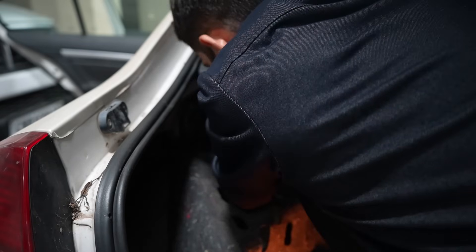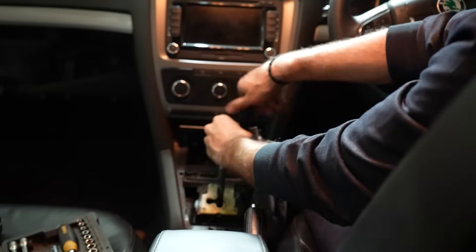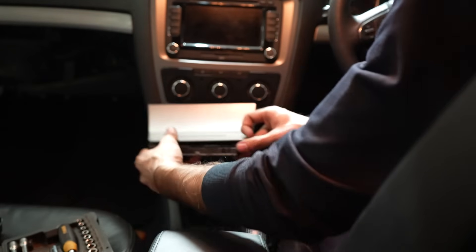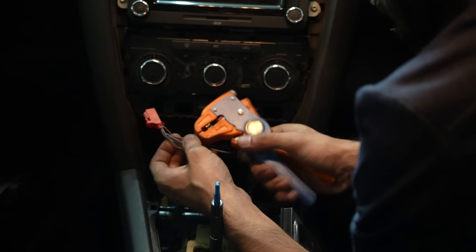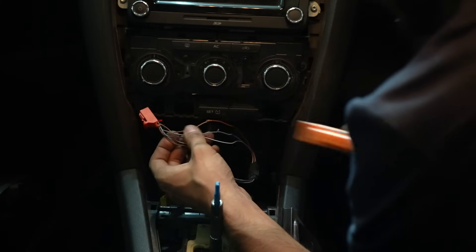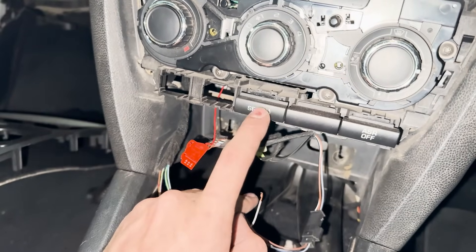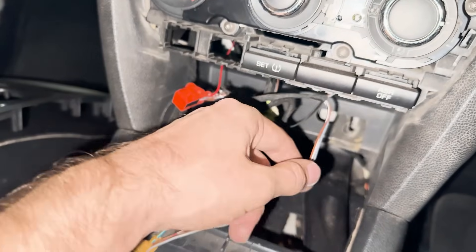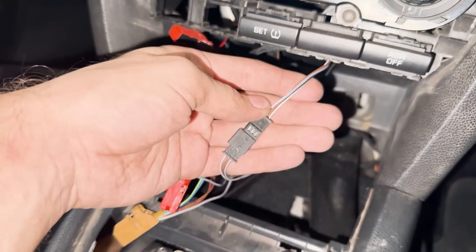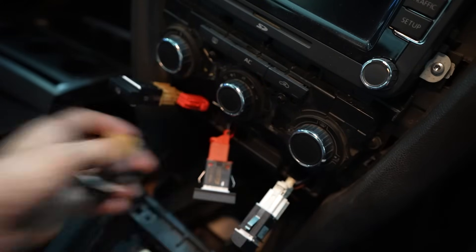Now to just pull this harness to the module, taking apart a bit more of the interior to lay down the wiring for the buttons and the front buzzer. I route the newly made harness along the factory harness and then make the necessary connections of ground and illumination for the buttons along with the previously added set button, without tampering the original factory harness — just the added adapter harness. I then quickly connect it to check if I made the correct connections, and I sure did.